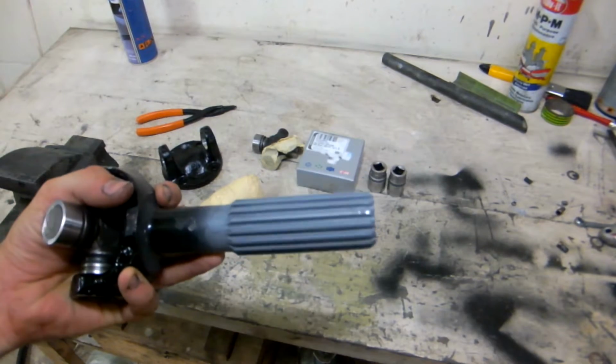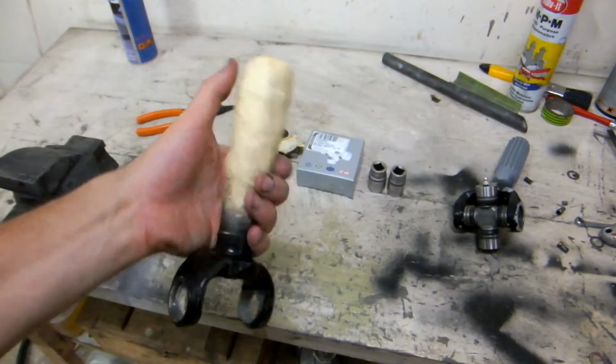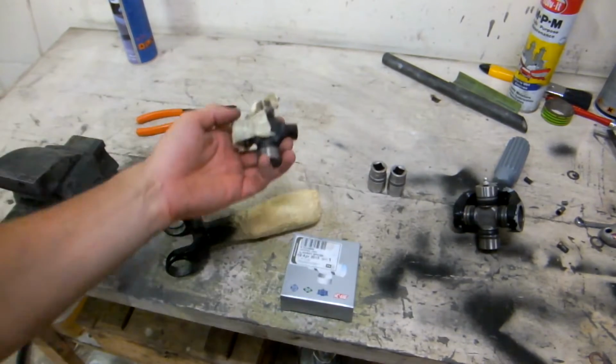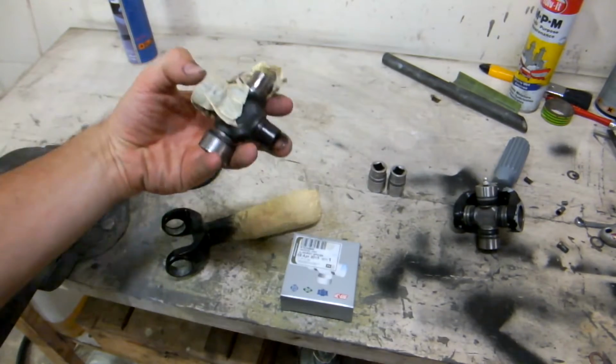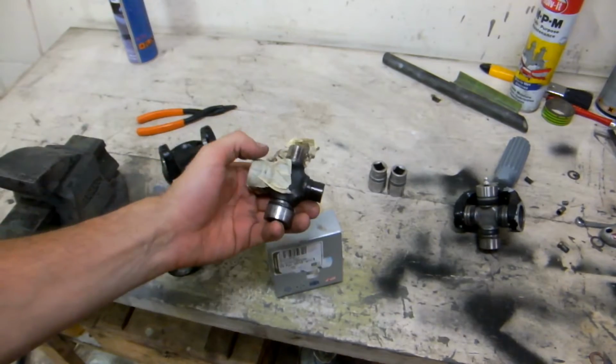But when I placed the yoke back in the prop shaft, there was so much play that I knew something was wrong. So for starters, I had to buy me another complete prop shaft. Also, since the U-joints have already been installed, it is possible to take them out, however some of them got damaged upon removal.